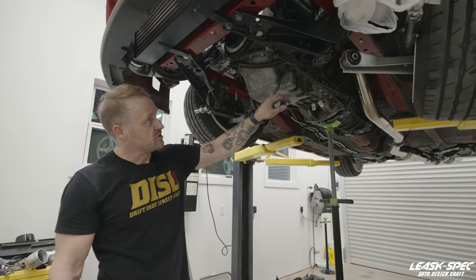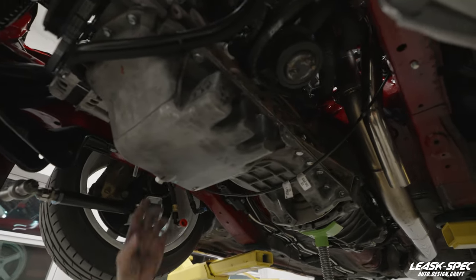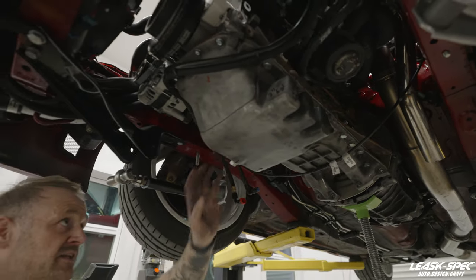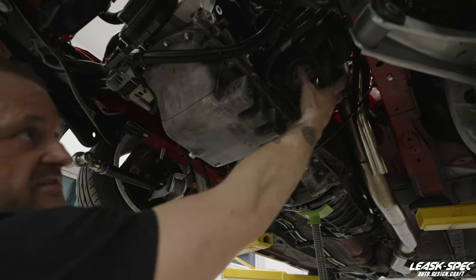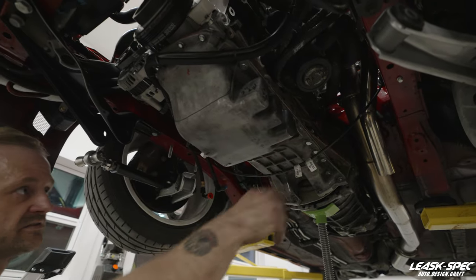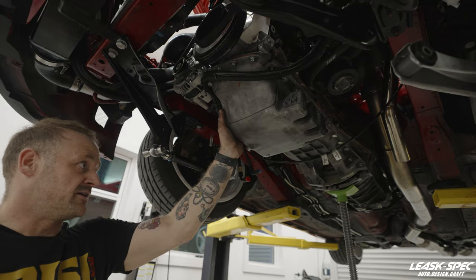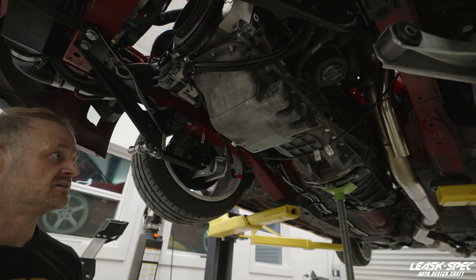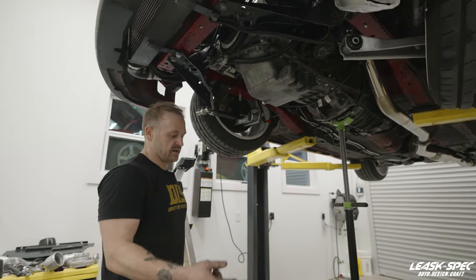So what I did — you'll see some notes on the oil pan. I kind of noted my clearances and what I have to work around. I was a little bit more ecstatic about being able to get a gargantuan extension in there, but the problem I ran into is this motor mount setup kind of juts forward, whereas the GTR sticks back a little bit. So I'm still going to have to cut the wings out around the motor mounts. Anyways, I made some notes, I know where all my cuts need to be, I know where all my clearances need to be. So now I just need to finish getting this pan off tomorrow, cut it, get it ready, build the custom extension, and start thinking up some ideas for the catch can. Now I kind of want to catch you up on where I'm at on the R34 GTR.